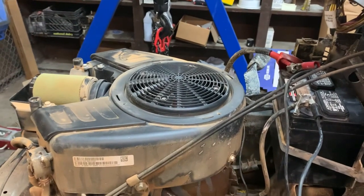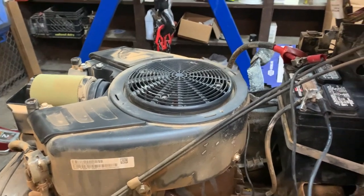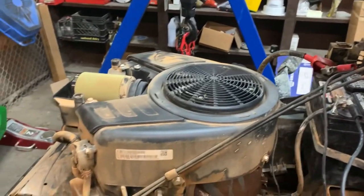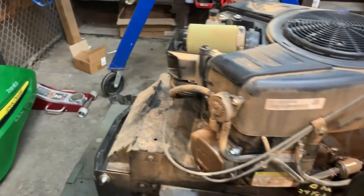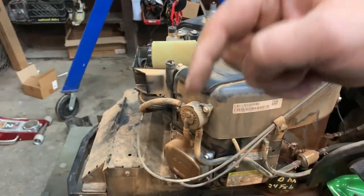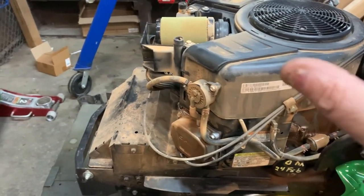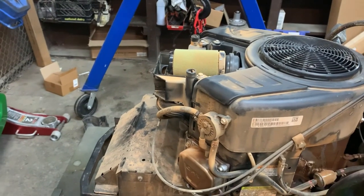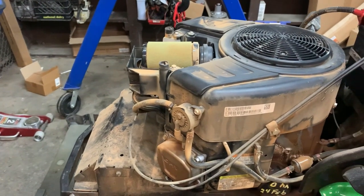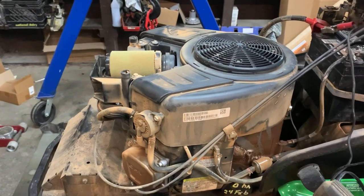Surging at wide open throttle. Obviously we're going to have to go through the carburetor. Has no idle. When I pull it to idle, it does absolutely no idle. So we're going to have to go through this carburetor. Like I said, I'll link in the description below where you can find that video where I rebuilt this carburetor.